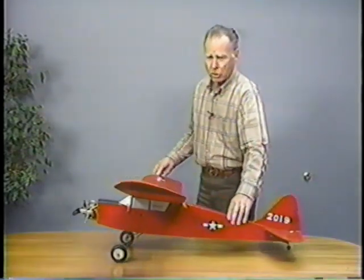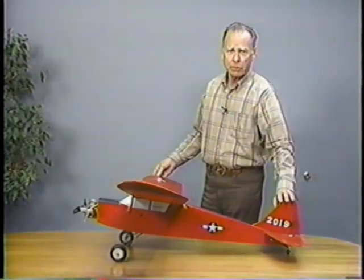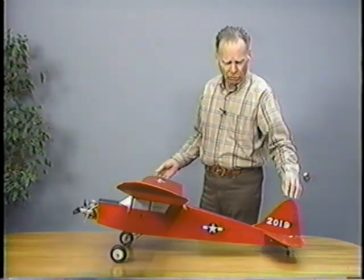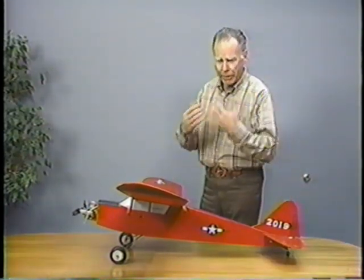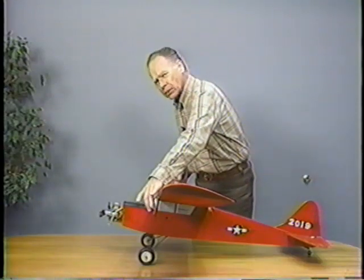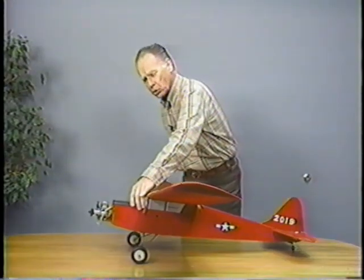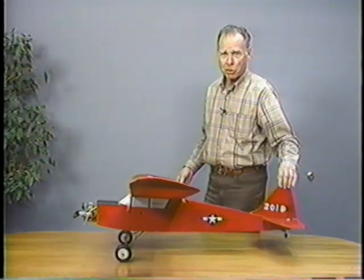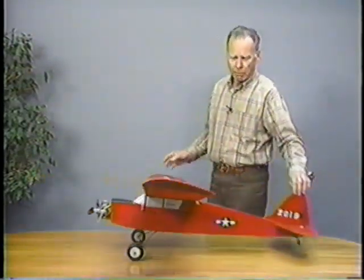So directional control is much more critical with a tail dragger than it is with a three-wheeled airplane. A three-wheeled airplane is more forgiving, basically. You can relax the back pressure and take your eyes off the runway, and it'll swerve around a little bit. But as I said, remember, the natural tendency of a nosewheel airplane is to straighten itself out. The natural tendency of this little beast is to swap ends. Don't let it.